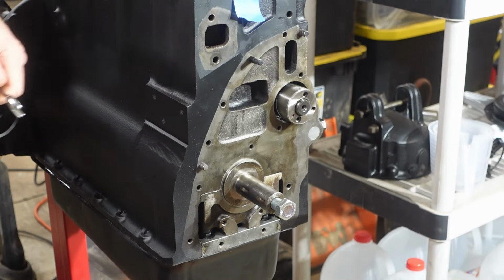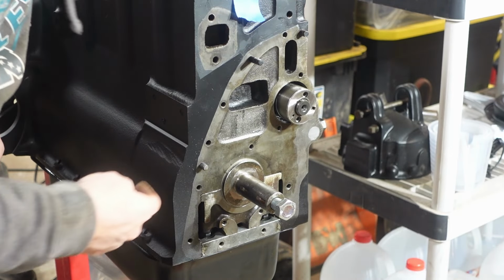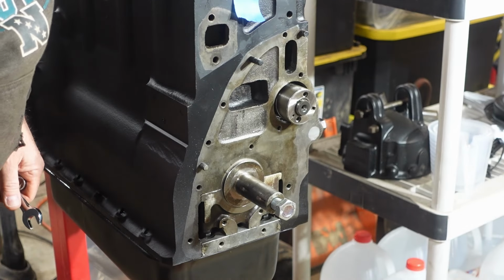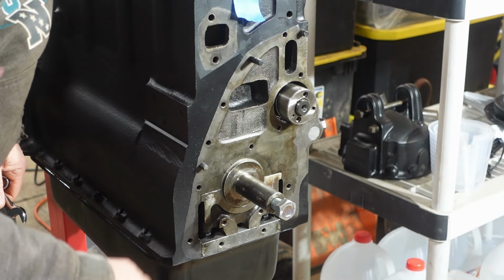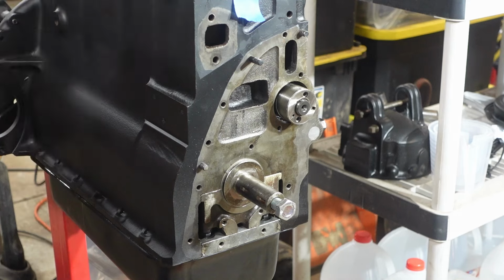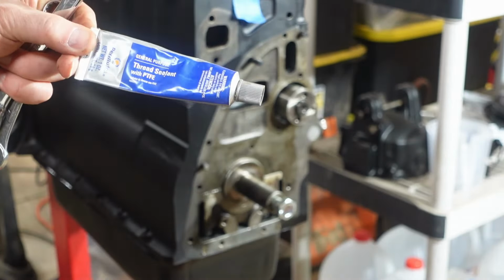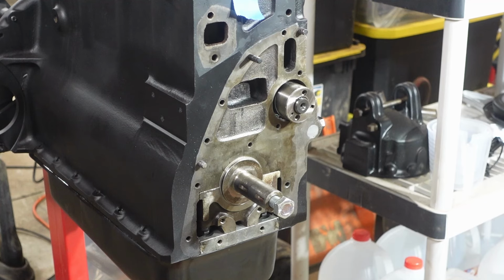Now, some of the bolts that are going to hold the front engine plate on penetrate, the holes, I should say, penetrate into the water jacket. All right, so these two up here do. This one here, but that's for the water pump. And then a couple of the ones at the bottom are going to penetrate into the oil. So for those, I'm going to use thread sealant, just Permatex with the PTFE, just general purpose thread sealant. I'll put the link in the description here. It's the same thing that I used on the Spitfire. I haven't noticed any leaks from any of the stuff I did there.